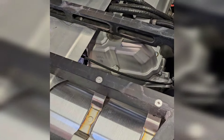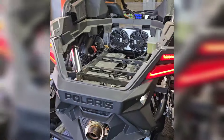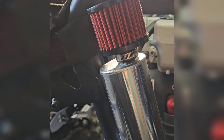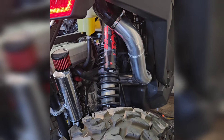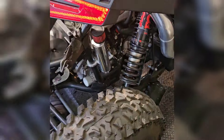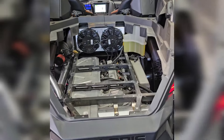We have the paper air filter hiding inside here, and that also goes back up to the stock airbox. Over here you have the catch can — we've been running this thing for most of today. As you can see, the filter is still pretty clean so the catch can is doing its job. We have a nice aluminum air intake for the clutch there. Down in the filter area we have an oil pressure sensor, so for the guys that have lost oil pressure and blown their motors up, the standalone will shut the motor off if it goes below a set threshold oil pressure.